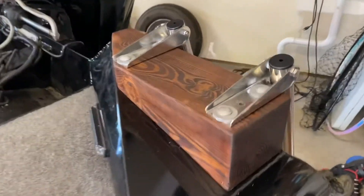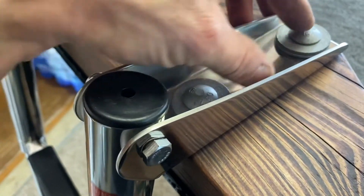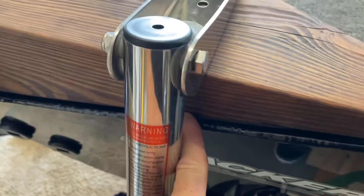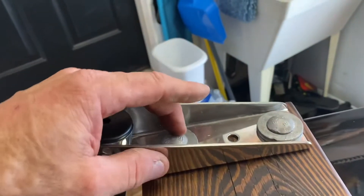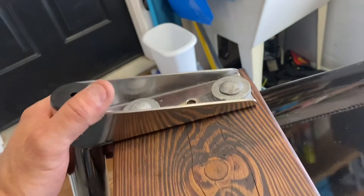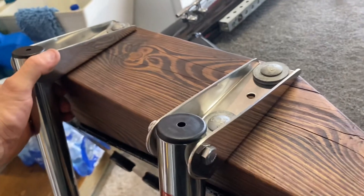The ladder is now mounted. I had a heck of a time with the nuts underneath — it comes to just a couple inches off the floor inside. The best approach would be to use a bolt that is exactly the right length so you can hold it from the bottom and spin the top tight. Three of the four bolts got really tight; the far one I could only get snug due to the tight access. But this thing is solid — it is not going anywhere.